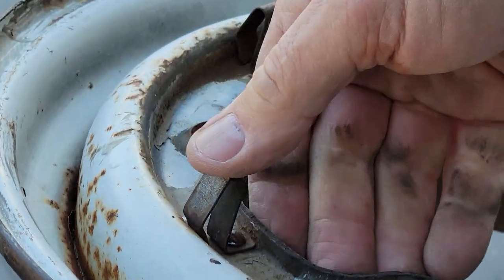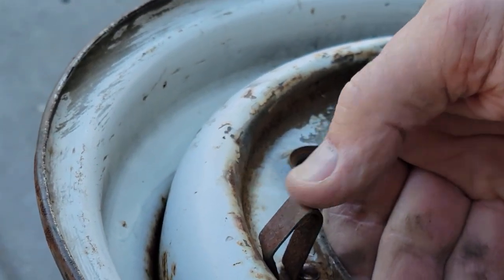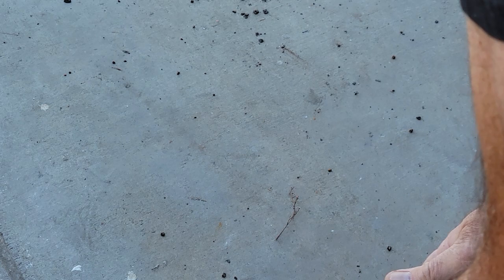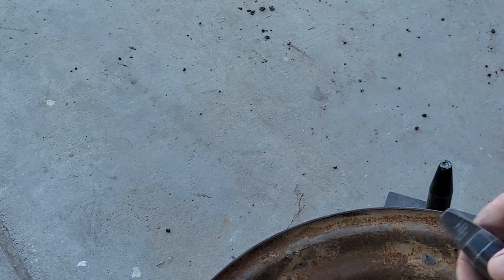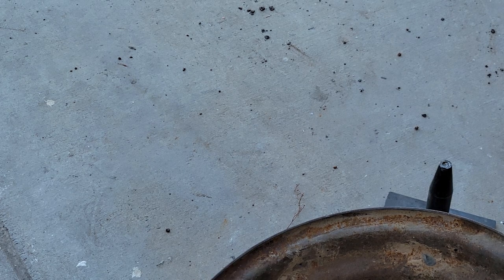The clip is on there really firm. There were two other loose ones on this one from somebody who tried to use a punch or whatever they used. You don't use anything but that hammer — when you use anything other than that hammer, that's when your clip is going to fall off or come loose. So a nice big three pound hammer. If you have a welder, weld on a piece of plate. If you don't, you can balance it and hold it in place the same way. Put the clip on the tool — you see this little groove, that's where the clip goes. Put the little rivet on top there. Beat it with a heavy hammer. You're done.